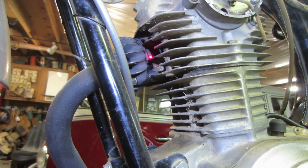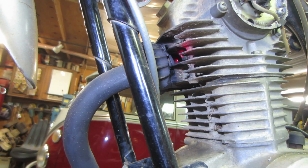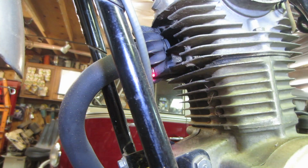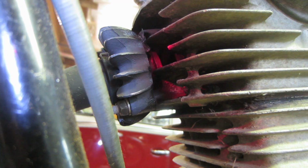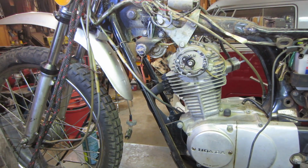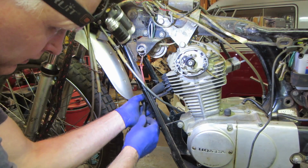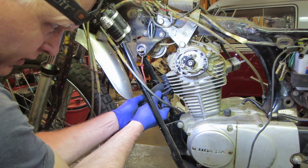I don't know if you guys can see it, but the distance between there and there's got to be a good, I don't know, half-inch gap. That's where the exhaust leak is. So someone either doesn't just have that right together. I have a feeling that maybe those retainers are put on backwards. And what do we say? We take those two nuts off of that flange. We'll pull that back. You guys see what I'm talking about? Right there, so I can shine right into the port. That's your issue. Let's go pull that flange away. One of the nuts is already off. I have a guess, but I have a feeling there's like two keepers that push against the pipe. I have a feeling they're in upside down, and it's just not pushing the pipe all the way forward.